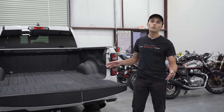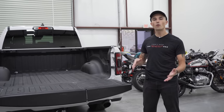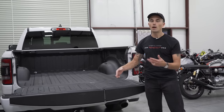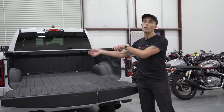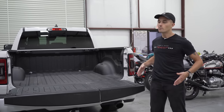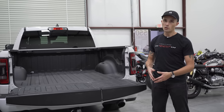This method also involves riding the motorcycle straight up with the ramps. If you're not comfortable with this, there are other methods in which you walk the motorcycle up using a step ladder system. However, I don't recommend those because you can very easily lose your grip on the bike and it can fall over to the side. If you just ride the bike straight up with two ramps side by side, it should be a lot easier and anyone can manage to do that as well. But you just have to commit. We'll show you guys how to do that.